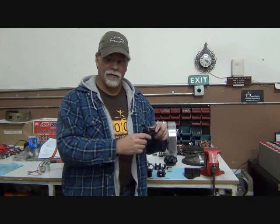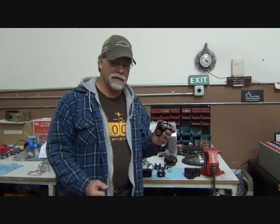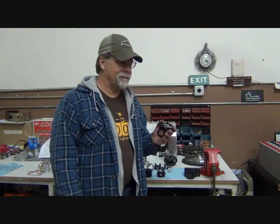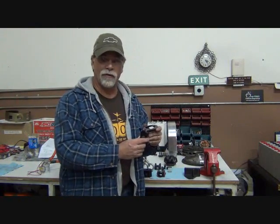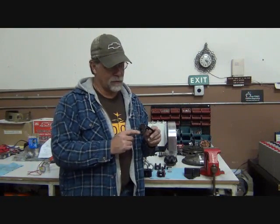And third and fourth. So in other words, the Karmann Ghia was notorious for being difficult to get in second gear, and that's the gear that we took off in all the time. So you come to a stop, you put in the clutch, you put it in second gear. You typically had to go forward and back a couple times to make sure it was all the way over and going in second gear. Many a time I went to take off and you find out it's in fourth gear, and just not quite the acceleration in fourth gear as you have in second gear. So anyway, that's because of this bushing being worn, and I'd be willing to wager that this piece is worn as well.